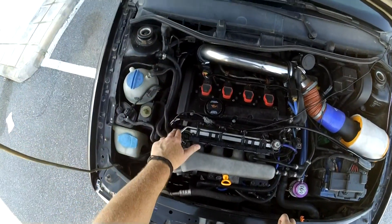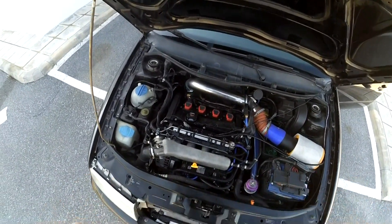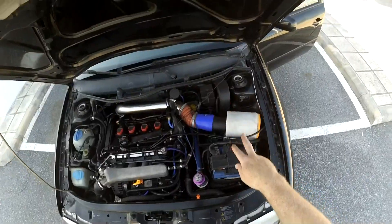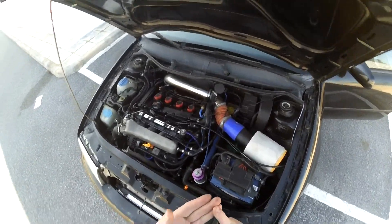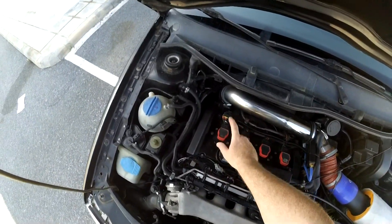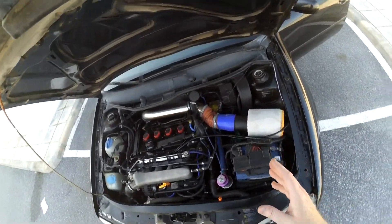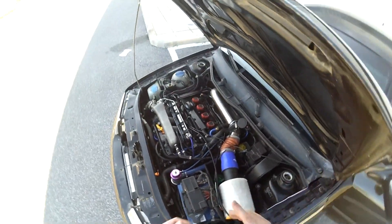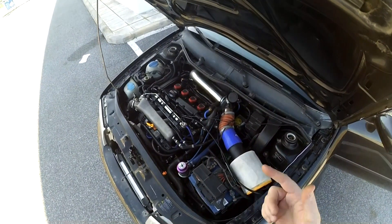For the wiring, we've got two sensors mounted to the cylinder head. We've got one for the laptop so we can monitor the knock sensor signal with headphones, and the second knock sensor is going to be feeding the signal to our knock sensor ECU. The knock sensor ECU needs power — ground and 12 volt power. It needs an RPM signal, which we have run a patch harness to COP pack 1. On this specific application, at least to start with, we're not going to be using the load function in the KSC3, so we have bridged that to a 5 volt power source. We've run a lead into the car which will display a blue, orange or red colour depending on how often the knock is happening and how severe it is.